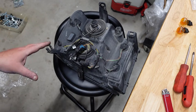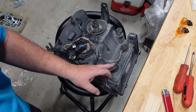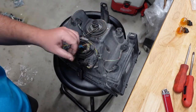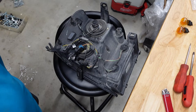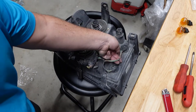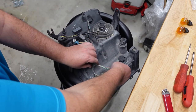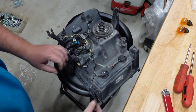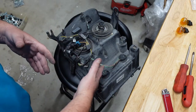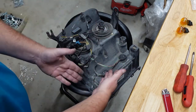This is the driver side headlight. These are the turn signals. If you have a Chevy that has the blue wires, this is not going to work for you. This is only for your 2007 to 2013 GMC vehicles. You've got one black, two greens up here, and two tan or two brown wires. These are our turn signals on the driver side. This is going to be the same for the passenger side — they're just going to be over here instead.